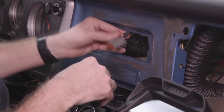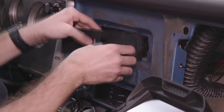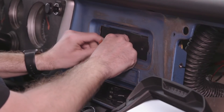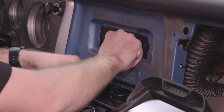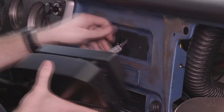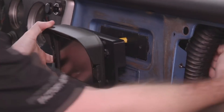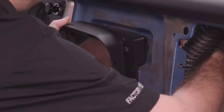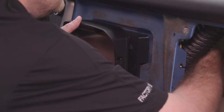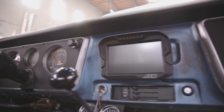We're going to take our backing plate and feed our wiring harness through it. This harness has power, ground, CAN high and low on it, as well as some spare digital inputs and a beacon input, so you can trigger things like turn signals and night mode. It's as simple as plugging our harness into the back of the dash to get a nice positive click. Put the studs in, give the dash a nice reach around, and that's it.